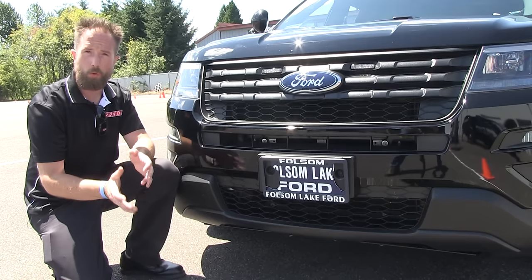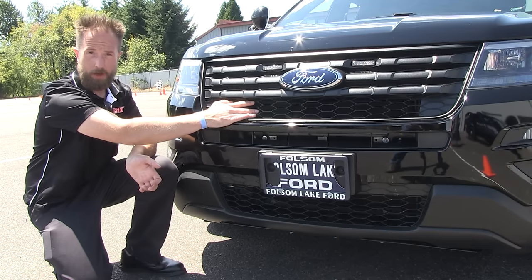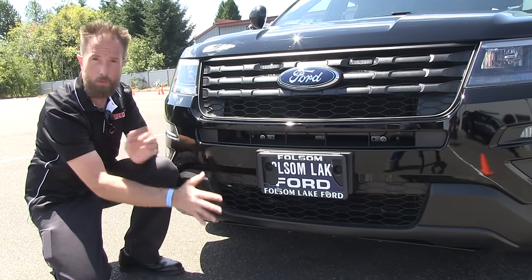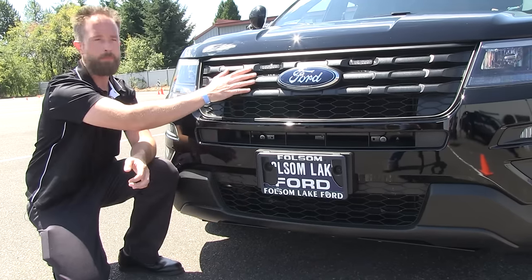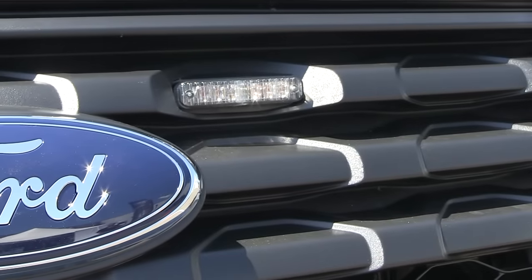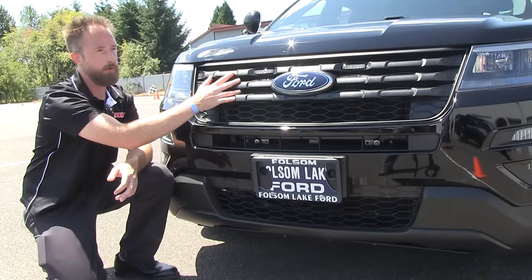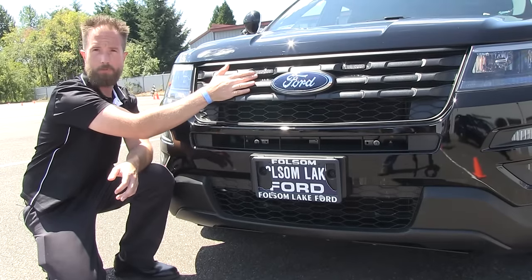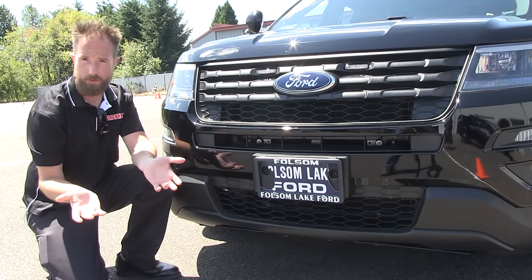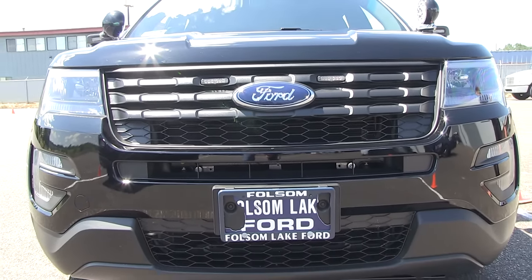Push bumpers will be available, or if you're not adding one to the front of the vehicle, lighting behind the honeycomb in the upper grille section can be mounted down low — different levels: low, mid, or up above the Ford emblem. Lighting product from Whelen Engineering — these are the Microns available from us here at SirenNet — are a wonderful compact light head to fit into the front grille. On these vehicles there is a removable plastic pop-on for the grille. Remove the pop-on, take the Microns, snap them into the grille, wire them up, and you have wonderful protection to the front of your 2016 utility.